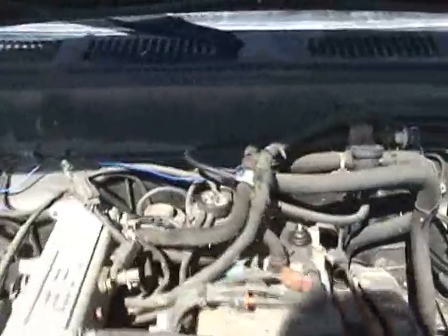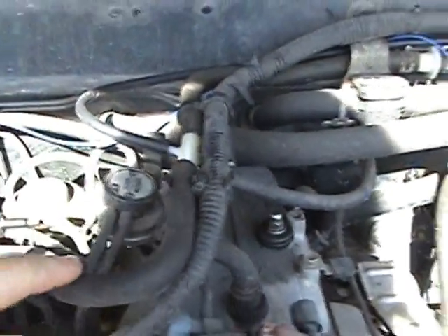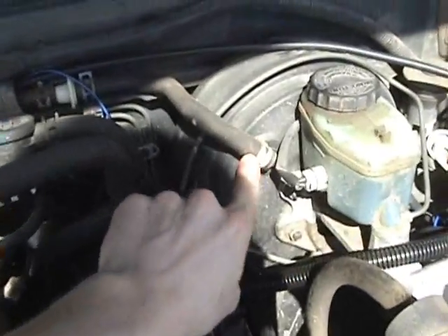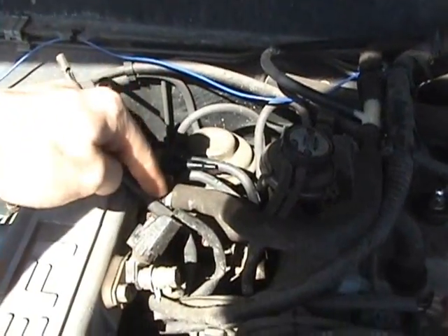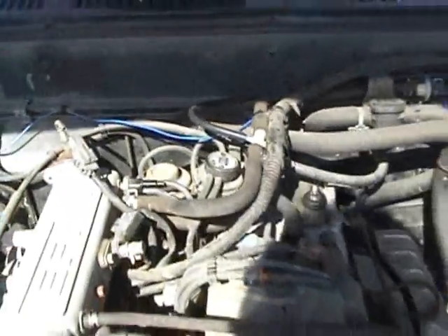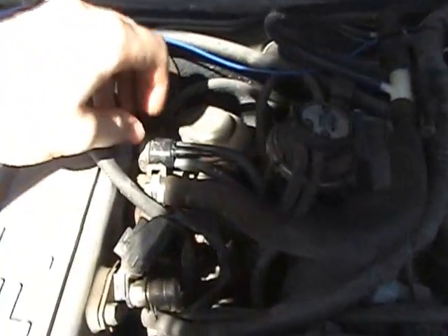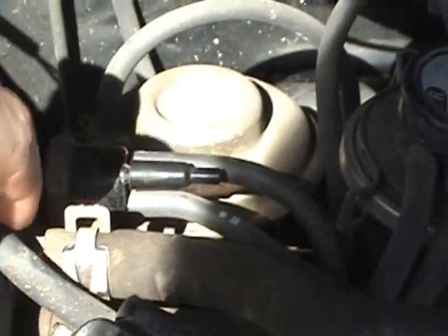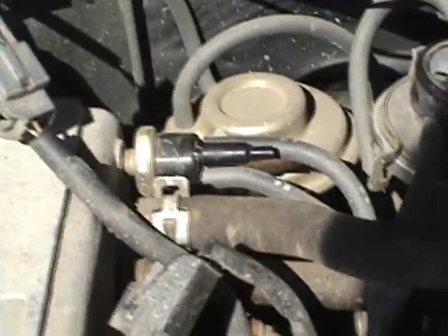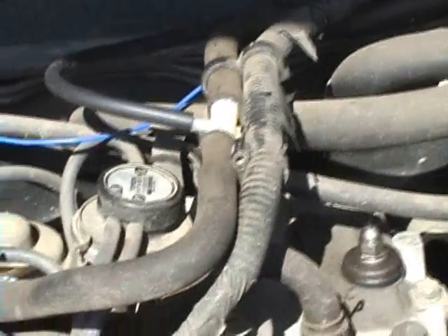Tapped into — well, despite what the directions said, they said don't tap into the brake booster hose, which is right here. It comes out of the brake doodad, goes around, and comes right into the engine right here. Instructions say don't tap into that. But I talked to the guy at the dealership. He said if this doesn't provide enough power or enough suckage, you might need to use a canister for that. Otherwise, just tap into the brake line — that should give you enough power. And happily, it does. I haven't had any problems with brakes.